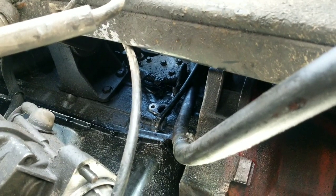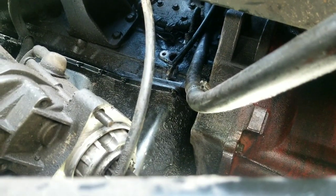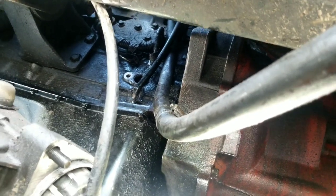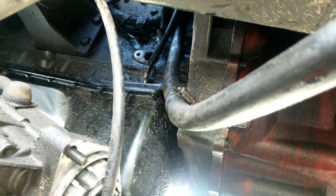So that's where your crank sensor is, right by your dipstick tube. The dipstick's in the way but not too bad. You gotta remove the starter — I tried without it. There's also a factory fuel pump there, but I have a fast pump on this so it gives you some more room.